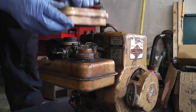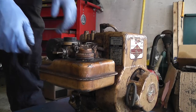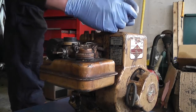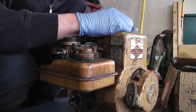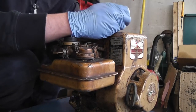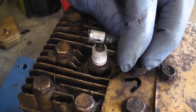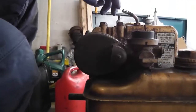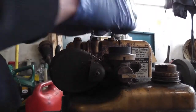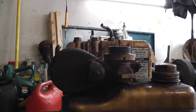If we're not getting a spark then we do have to get in deeper. The screw comes off there — it's a little carburettor with an integral tank. Okay, problem number one: the end is broken off the HT lead, so it's never going to start like that. What we'll do is take the end off, and since I don't actually have a new end for it, I'll just wrap the wire around the top of the spark plug and see how we get on that way.